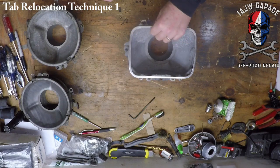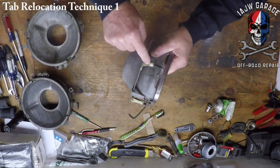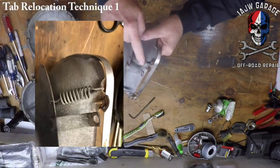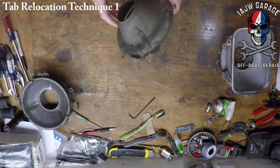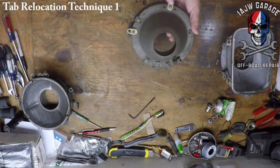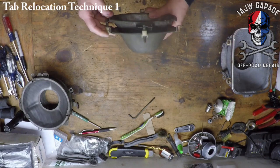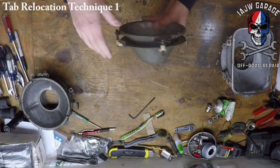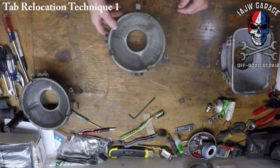What that's going to entail is removing this screw, removing this screw, and removing this spring from each. There's only three points of contact for each — the spring and two adjusting screws for adjusting the headlight up or down or right to left. So that's what we're going to do.